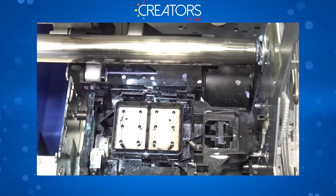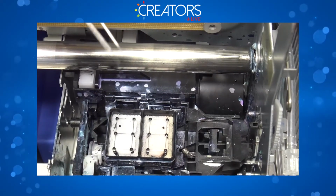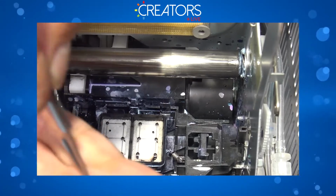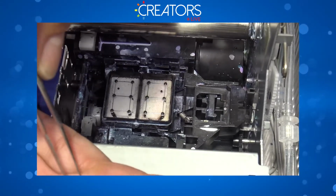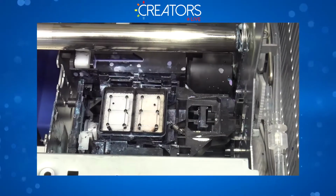So you can see right there on the capping station, there's like a little hair of dry ink. A tool that I always carry with me is this needle, a super fine needle. I also suggest you get something like this because it will be very useful and handy when it comes to maintenance. So what you want to do is reach in and pull that. Right here, you do not want anything but super cleaner. So make sure you get rid of these little pieces of dry ink.